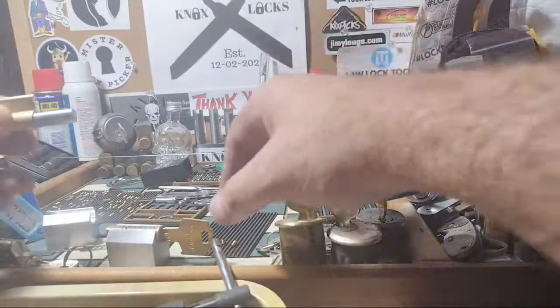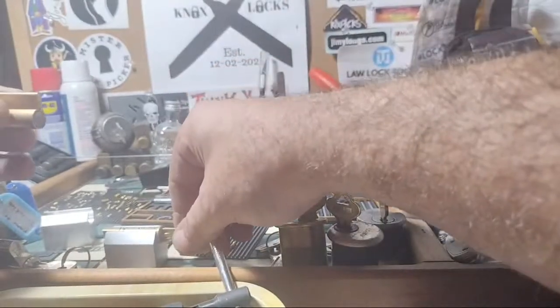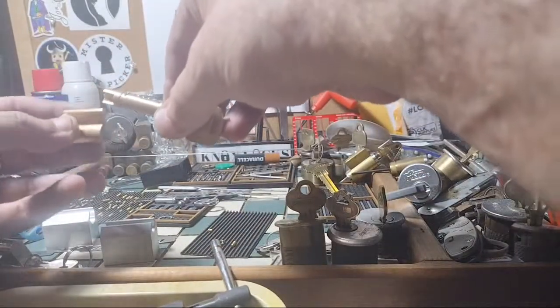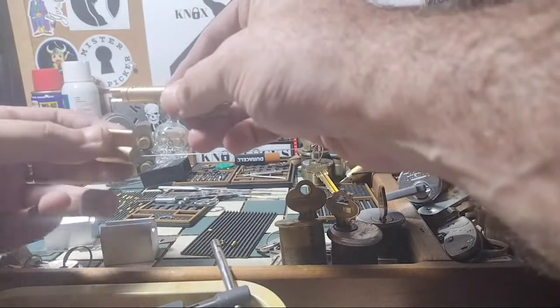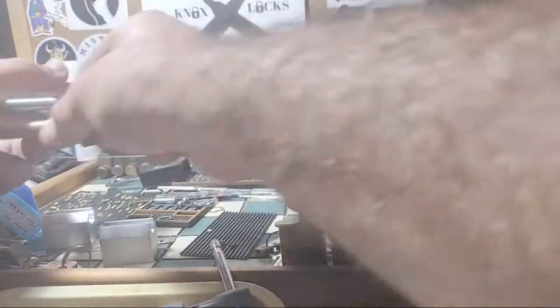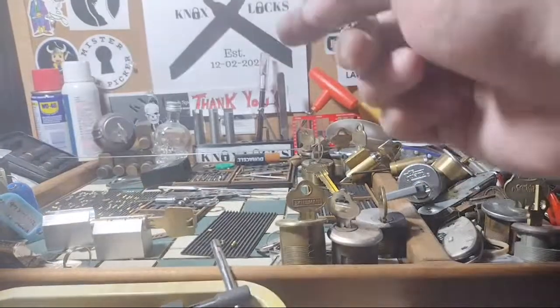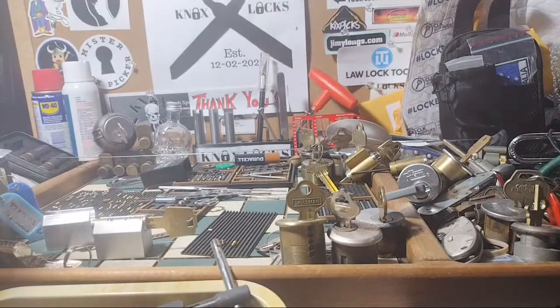Alrighty. I should probably be smart and use a shim with these mods, but at the same time, yeah, you know what? It's better just to be safe. I was just going to slam it through, but looking at the indentations of that retainer on the back of that, with my luck, one of those ball bearings will slip out right into there and seize the whole lockup. And being I made it this far, well, let's not do that, right?